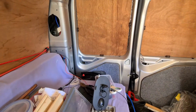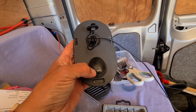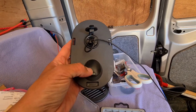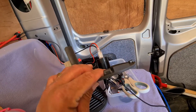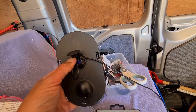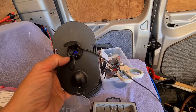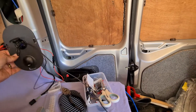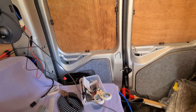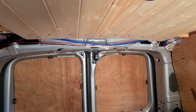The second-to-last switch is for the light wired on this side, and the last switch is for a USB socket I've wired in here. This one is linked to the main car battery in the van already, so I've put another one on the back there. So when you're in the bed or lying or sitting in the back you can charge up via the leisure battery. See, that clips into the side panel down there - I might swap it to a higher position so you can easily get to it.